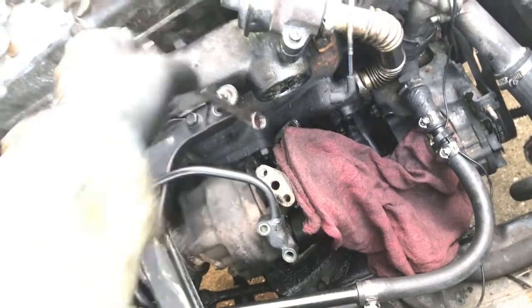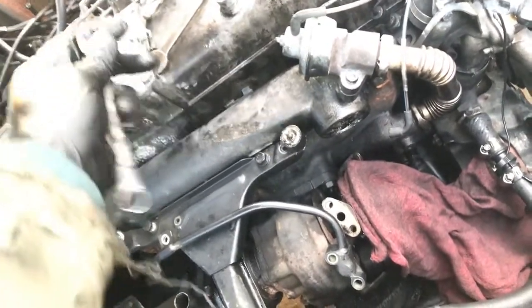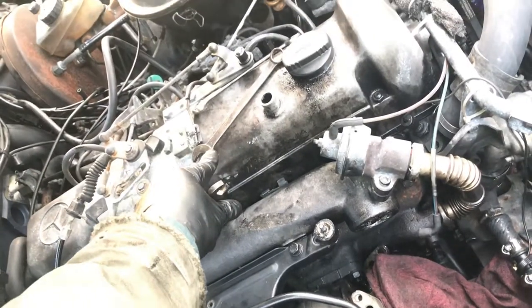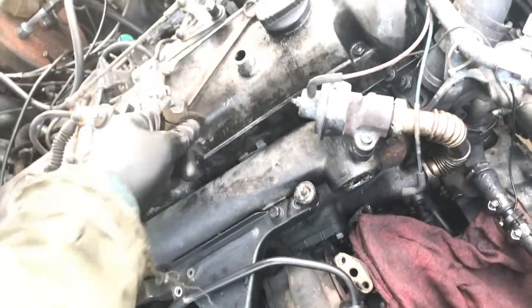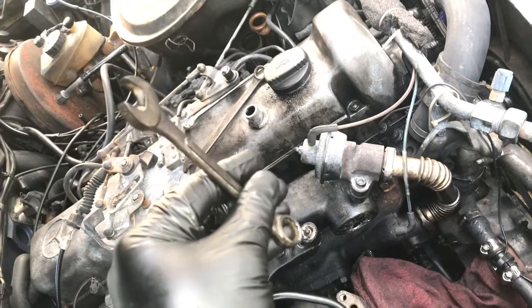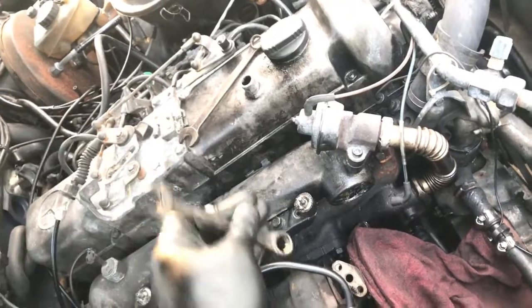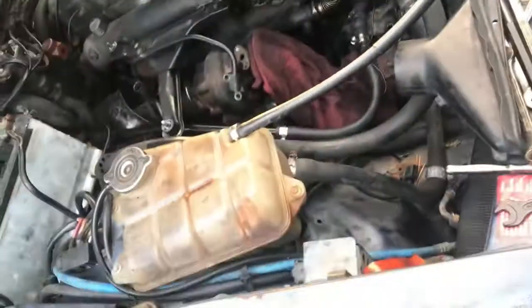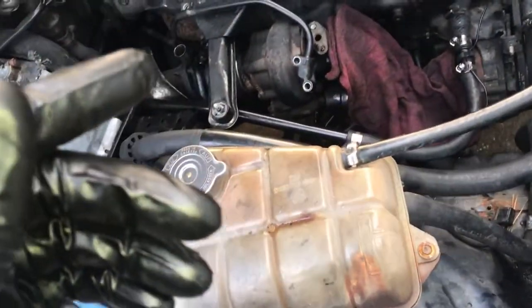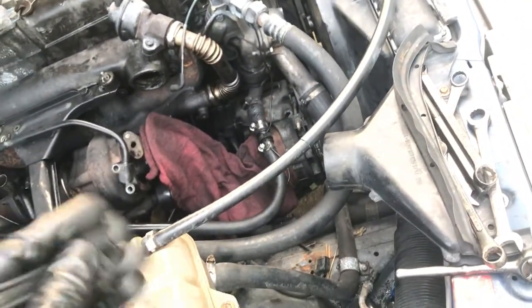It wasn't enough to get the other wrench on it. I could get one, and I have my sequence. This one, then this one, then this one. Repeat the process over. Go back to this one, this one, this one. The notches were oriented in these wrenches just so that, on those turns, I could get that sequence of wrenches in. And once I got it loose, I actually went to the bottom, because you don't have any leverage on the bottom, but you do have a little more swinging room, and got an open end wrench on it and loosened it up.